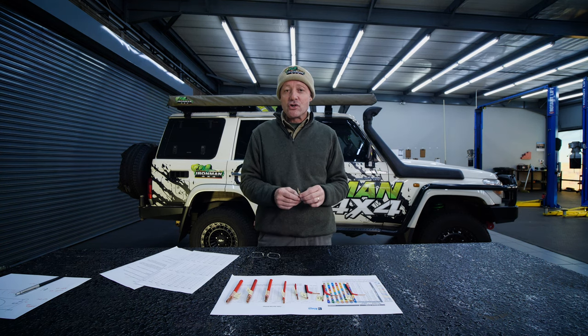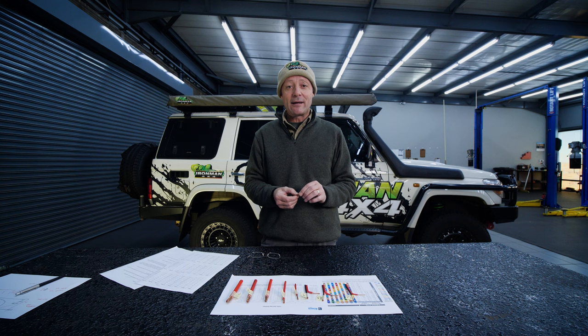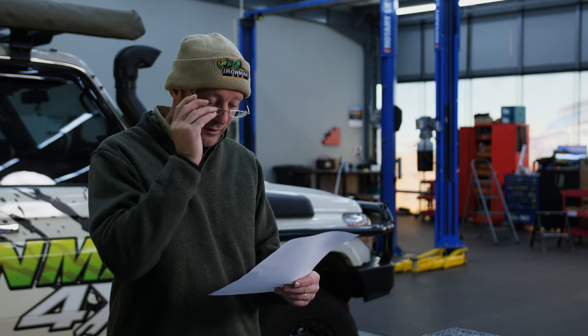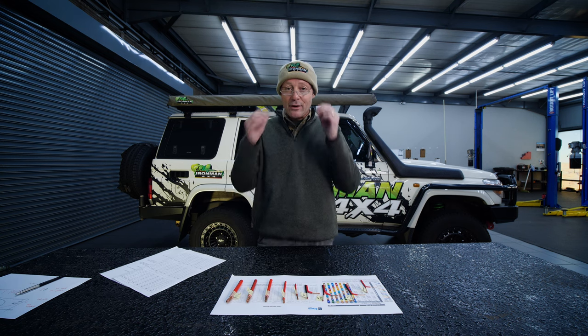If you plug your fridge into that plug point and switch the fridge on — and the fridge is warm and it goes at full tilt — it may be drawing up to four and a half, even more than that, amps. Let's call it five for a round figure. We actually traced the length of wire from that plug point all the way to the front at the battery in a popular Japanese SUV wagon and found that length to be seven metres long, no less. Here at Ironman 4x4 we then revert to this table of truth, and if we look at what the voltage drop will be on a seven-metre piece of wire which is one millimetre in diameter, having an amperage of five amps drawn through it, we will see that the voltage drop is a significant 1.2 volts.